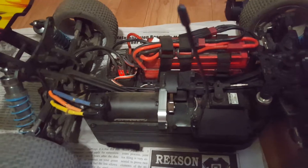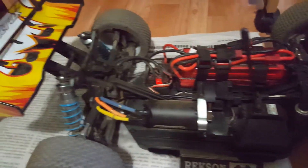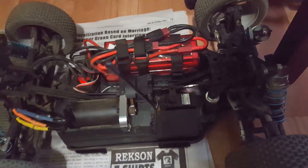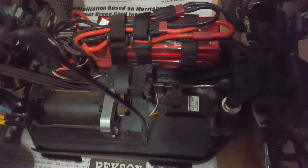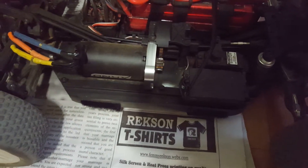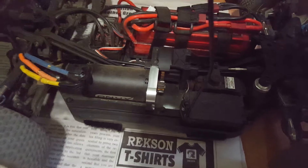It's a nasty sound. As you can see the rear is not getting any power, and the front diff is just spinning. Even the front is not getting any power, so it seems as though this is the center diff.